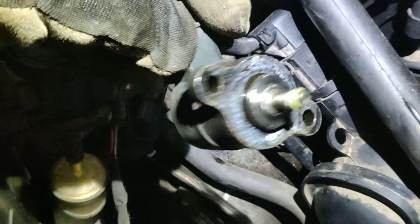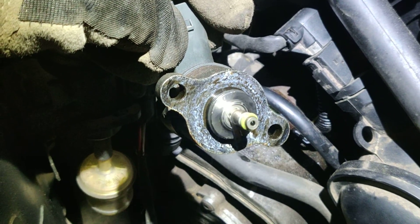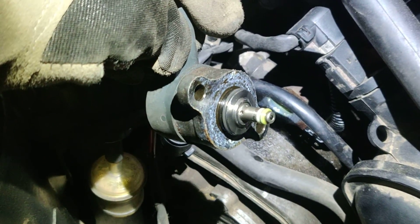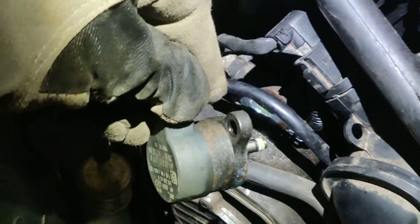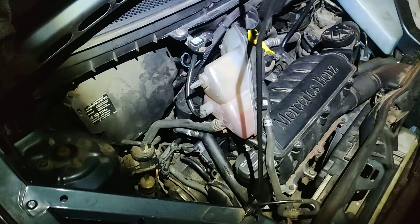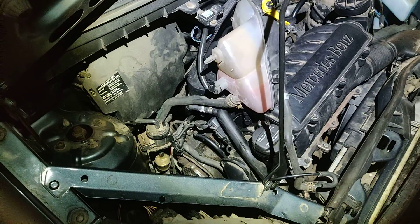The only thing you can see with diagnostics is that this valve is regulating pressure on the rail, which is jumping from 20 to 30 megapascals, or from 200 to 300 bar. It drops up and down, and that's why the engine is revving by itself all the time. So let's exchange this one.